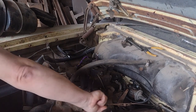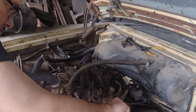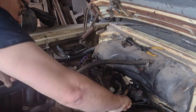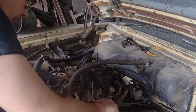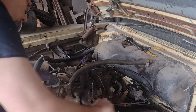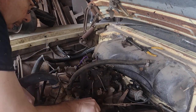because it's an older car, they equip these transmissions in these older cars with a rear pump. And a rear pump allows the transmission to provide fluid pressure. The pump provides fluid pressure to the transmission, and that is transmitted through the torque converter. You can actually push start these cars. I think it's 25 miles an hour or something like that. So it's something they got rid of early to mid 60s, I think.